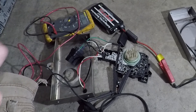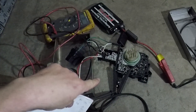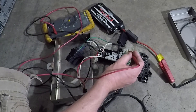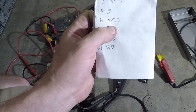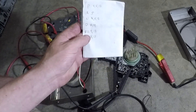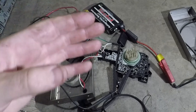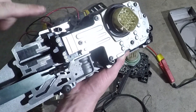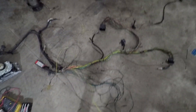So I went through each selection and checked the pins, and basically here's what I get: Park is pins 4, 5, and 13. Reverse is pin 5 — so we are currently in a reverse position. Pulling this jumper out and having those three pins connected again gives us Neutral, which is pins 4, 5, and 8. If you want Drive, it'd be pins 8 and 9. Drive 2 would be 9 and 13, and Drive 1 would be 8 and 13 — each showing a different indication on your truck. That little slide gives different grounds for each pin to tell the ECU what gear it's in.